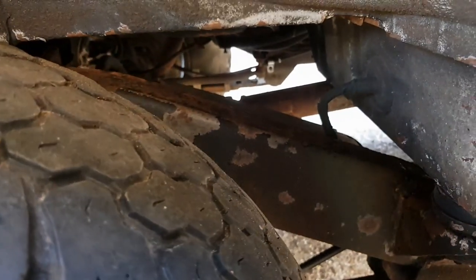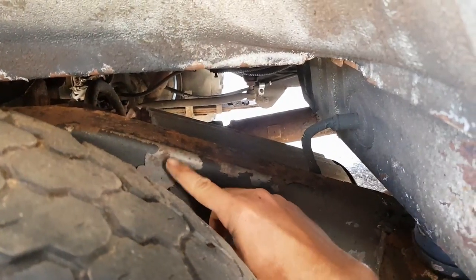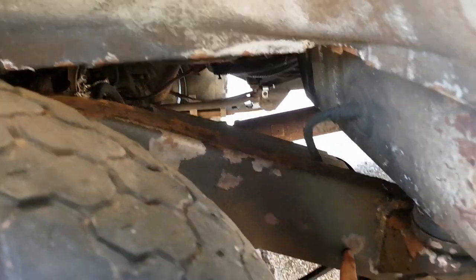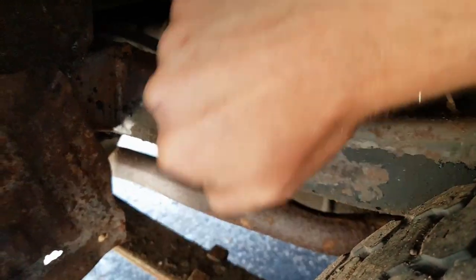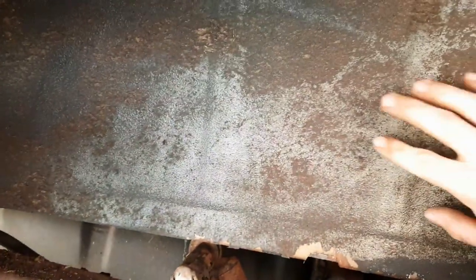I think it's waxy oil, but look, I'll show you now. You see, I've power washed this, but the coating that was on it is coming off, and that is actually clean metal on the chassis. And this is the rear of the chassis leg. You look, these normally rot terribly on these trucks, and that is completely solid, so I'm very happy about that.